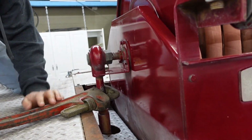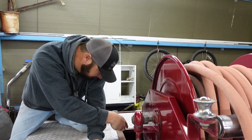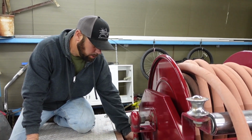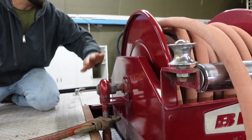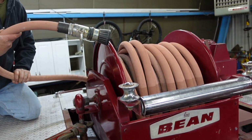So what we're doing is we're gonna take this pipe off. There's a hose that goes up underneath to the existing pump, but where we're gonna be doing away with that, we wanna come up and we'll thread in a whole new line off this, so that we can feed this hose and be able to spray this nozzle while we're driving the truck.